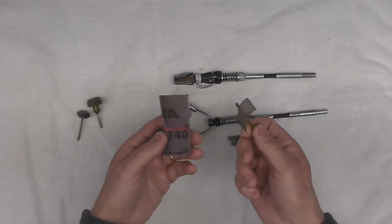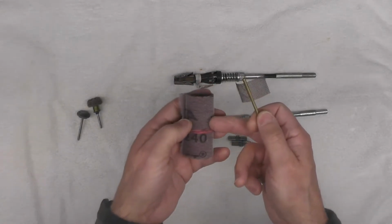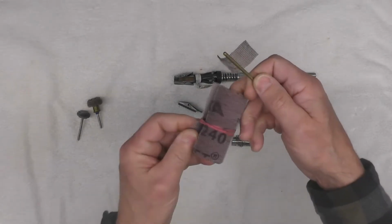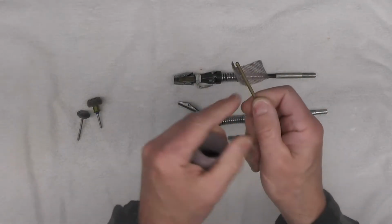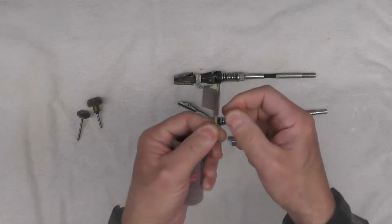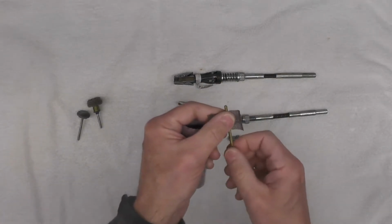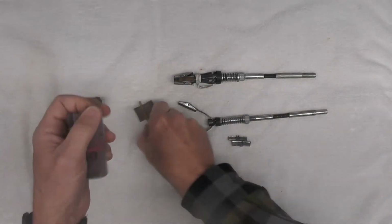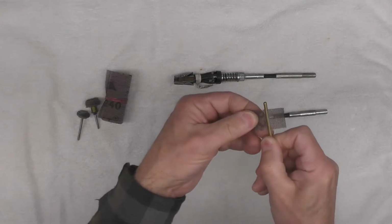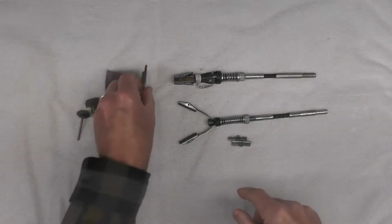This also is designed for use on a Dremel, a rotary tool. You can cut sections of this abrasive cloth. This happens to be, I think, 240 grit. And there's a slot cut in this brass sleeve or brass rod. You'd need a longer piece, of course, for this technique if I was going to use it. But you cut strips of this and put it in a Dremel, and as it spins, it's an abrasive, and it really just abrades the powder coat out.